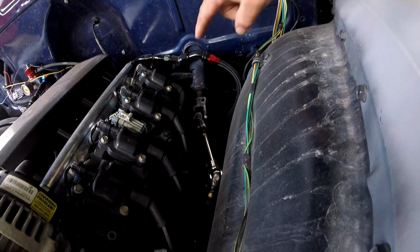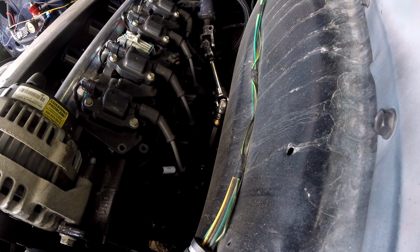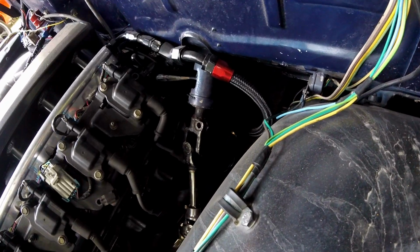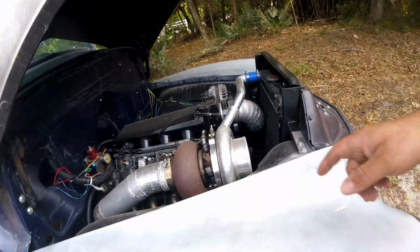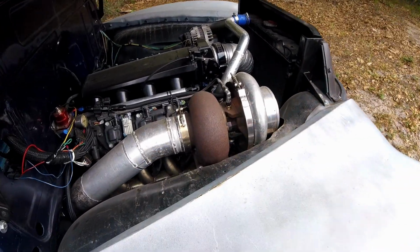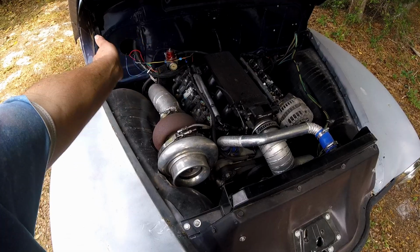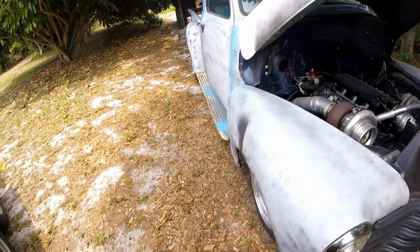As you can see, I ended up having to make steering to go around the exhaust manifold. I used stock truck manifolds, and then basically just made a crossover to go to the aftermarket. It's like a Silverado style manifold. It's got a 4-inch downpipe that goes down around the frame and kind of just drops off, right underneath where the step is.